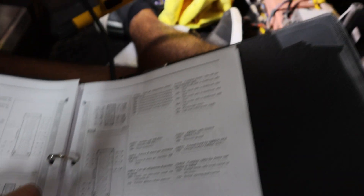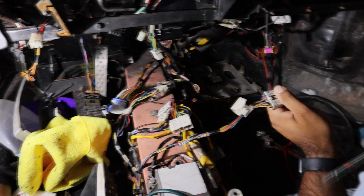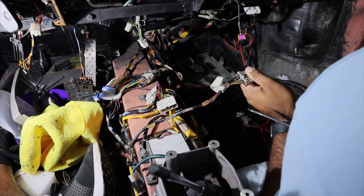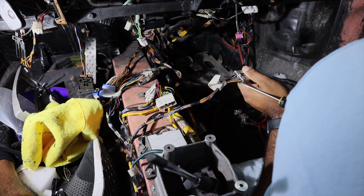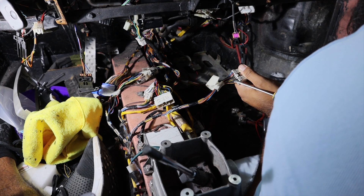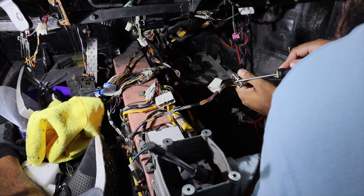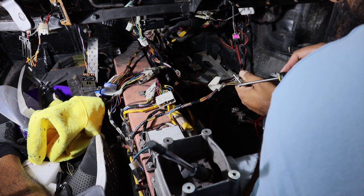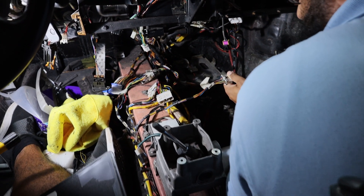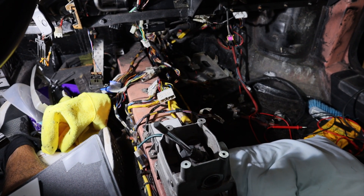This is connector 24D that Hchan was looking at, and if you look here you can see each of the wires in that connector. Hchan has the connector in front of him and he's reading out the colors — I'm confirming they match the diagram. First one is pink and yellow — yep. Yellow and black — yeah. Black and white — yeah. White and red — yeah. Red and yellow — yeah. And the last one is just blue — perfect. So those are all correct. There's a whole load of connectors we need to go through and check.